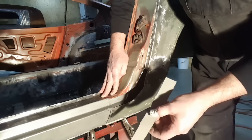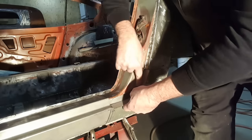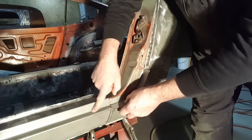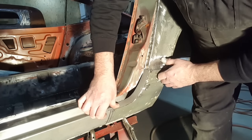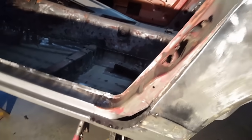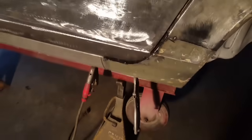All I've got done is I took this piece of metal here, just cut it up and trimmed it enough so it'd fit. I slide it in there like so — it's bigger than it should be, just trimmed up, sticks in further here, goes in past it, sticks out past it here. All I'm concerned about right now is getting this plane and this plane the same, so it flows from one to the other. I'm not concerned about wastage inside or whatnot. So I'm going to clean up this piece of metal and tack weld it in place. You can see the lines up, it's in and spot welded on — it's never pretty. I got it tack welded from the outside, and when I close the door I can look in and I'm happy with my gap. That'll be the door gap when it's done.